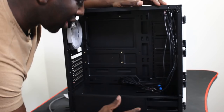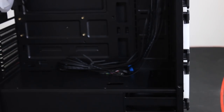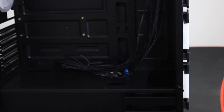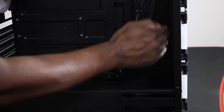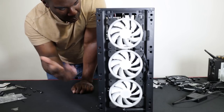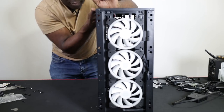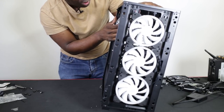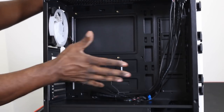Let's talk about the inside of the case. There's a nice deep cut hole for a 360 radiator, and you can put 120, 140, 240, 280, or 360 in there. I think you could definitely get away with a 240 in there. It would be a bit of a push but it would still go in. If you can get a 360 in there as well, the fans are outside while the radiator needs to be inside, so all you're doing is compensating for the radiator to go inside, then the fans are outside — taking cool air straight into the hot radiator and exhausting straight out.